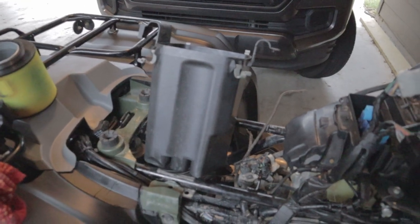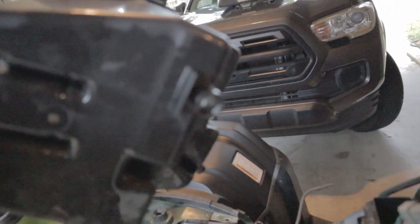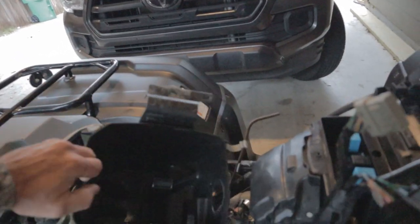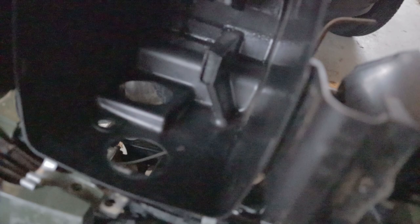The air box is somewhat clean. Don't forget there's a little tube that goes right there on the bottom — make sure you remove it, as we're going to be sealing that up also. Next step: we want this silicone to stick real good, so we're going to take a scuff pad and scuff all around the edges where we're going to put the silicone, to give it something to grab on to. I'll be back after I get through scuffing.